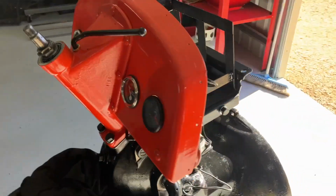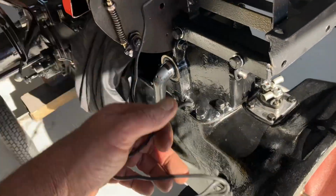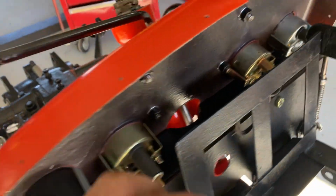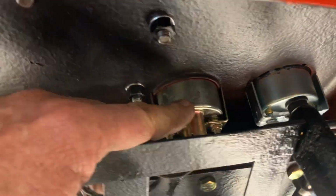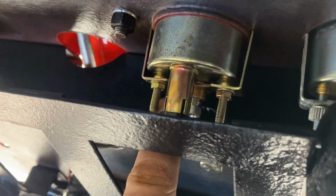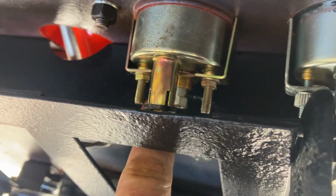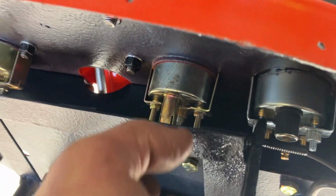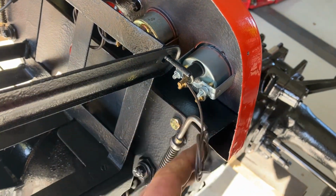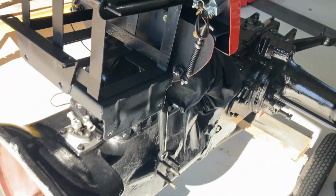The rest of it you've seen up to this stage. That's the temperature gauge sensor. Hour meter's just ignition and earth. New oil pressure gauge we got. Got the new fittings there. You can probably just make that out in there. That one there, 3/8 UNF, I think it is. I think Bundy Bear said, and that's what it was. And of course, ammeter. So, yeah, we'll just start tinkering with a little bit of wiring.